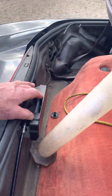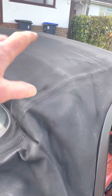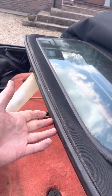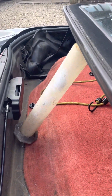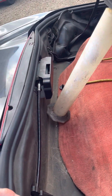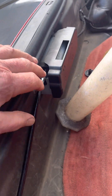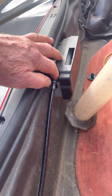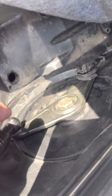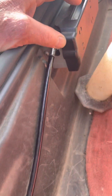We have a central motor here. You put the hood into service mode, which is basically lifting the hood partly up and unlocking it. You can use a tie to hold this up - I've used a measuring tape from the garage as it's about the right size. From the motor, two cables extend: one to the right side and one to the left side. There are two transmissions, one on each side.